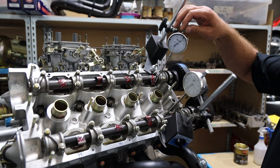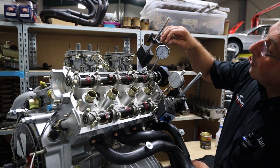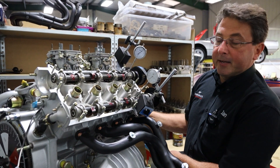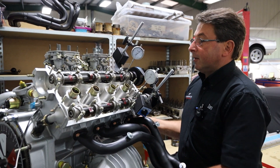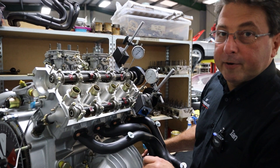These are very accurate gauges — when the pin moves you can see they're super accurate, they go around a lot. This will tell me when the cam starts to move, and then I can read off when it starts to move on my protractor on the crankshaft.